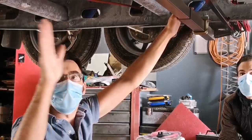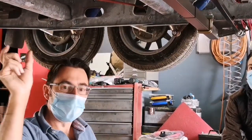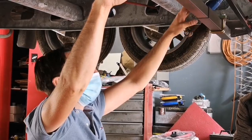and we're now ready to start adjusting it, getting the levels right, so we're out into the middle of the tyre, and then we'll put our little blocks in. We'll then tighten it all into position, and then we'll put our little grub screws into place and lock everything all into position.